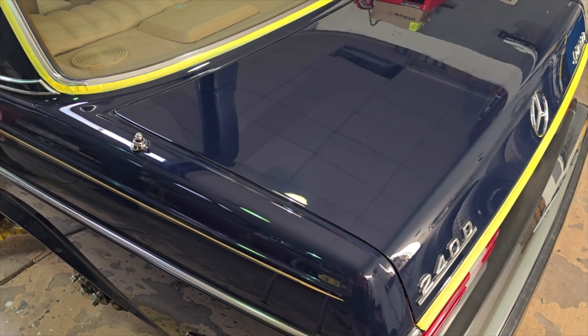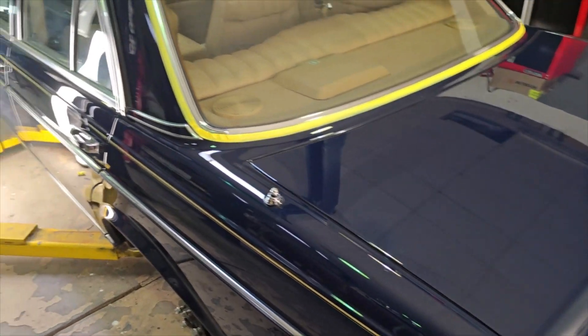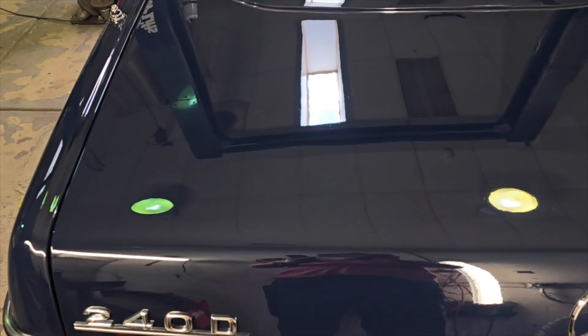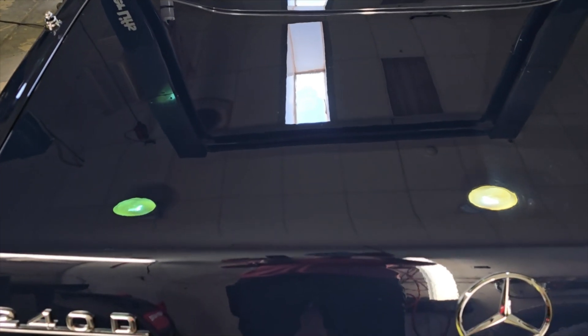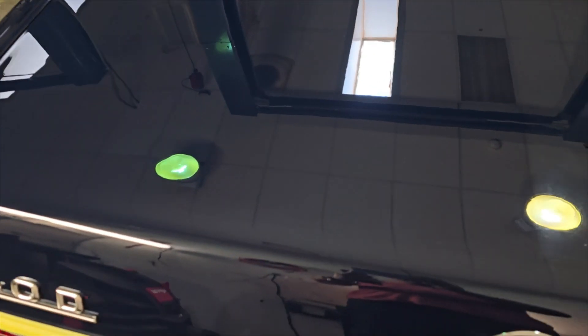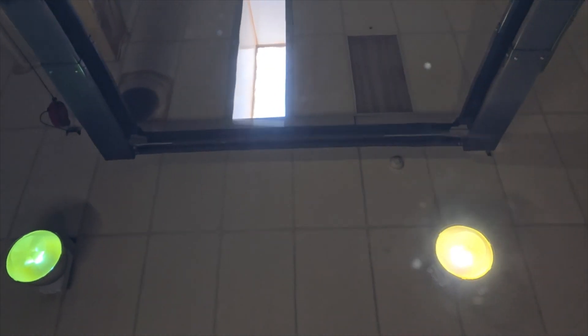Here's a little video of the polishing job I've been doing on this '83 Mercedes. It's been a task because I wanted this paint to be flawless and perfect. I've actually done 50% of the trunk — you'll see a line here. If you look at the light there, you can see the haze on the right. On this side of the trunk, you can see in the light reflections all the big scratches coming up in the paint. And like that scratch — brutal — just in the clear coat though.